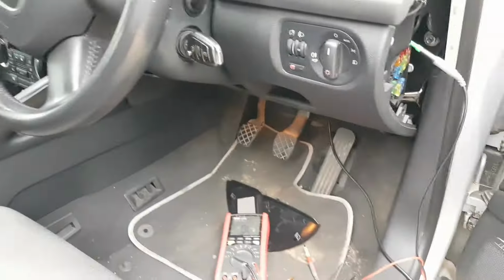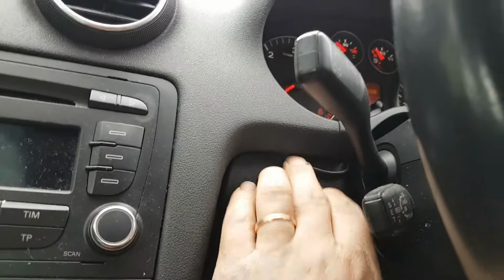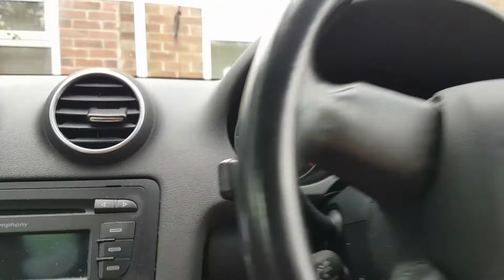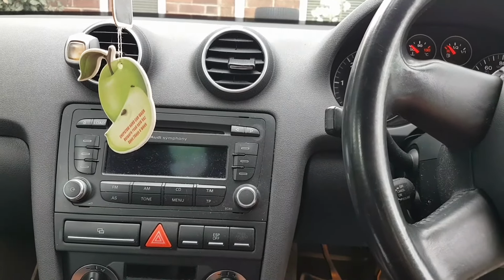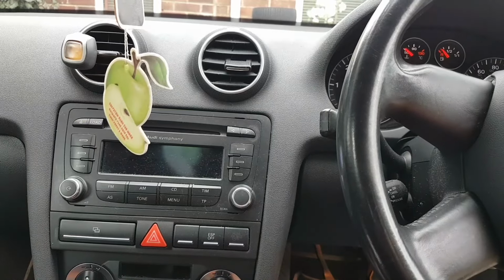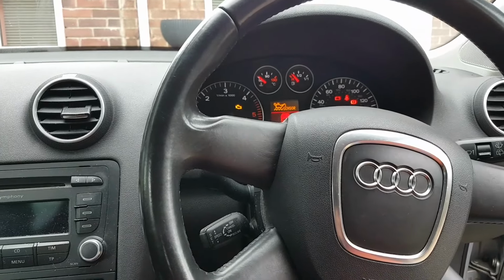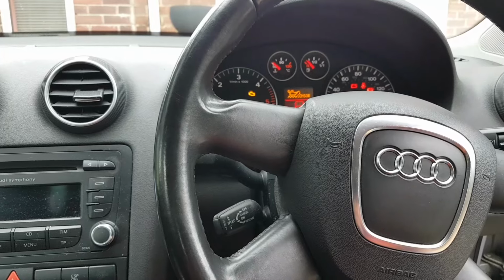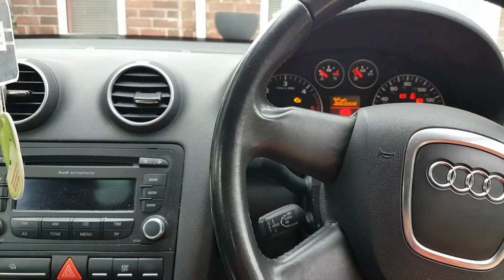Because look, this is not part of the car. Oh dear, this is not part of the car, and there's more. That's not part of the car. So I don't know if someone has been messing about with this. Well, someone has, obviously, and damaged something inside the car, but I'm not really sure if I should go there. Oh dear. I hope there's nothing wrong with the cluster itself. No, it's not the cluster. What I'm talking about is the 5 volts that is missing. The 5 volts are fed from this fuse. Still, it can be something wrong from here all the way to there.